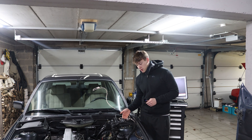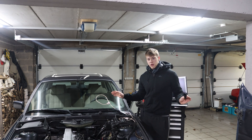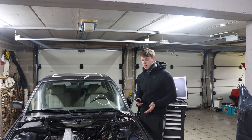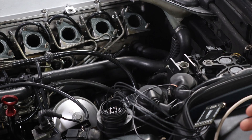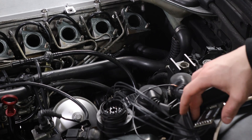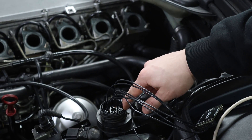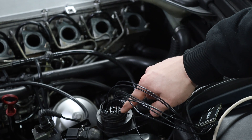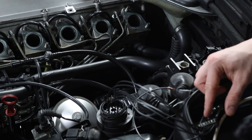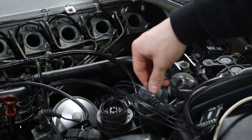Fast forward a week. I've got my tiny ADS interface and just a normal RS232 cable from female to male. Just plug that into the serial port and it instantly fires up — everything works a charm. If you have a car pre-1996, chances are you're definitely going to need the tiny ADS interface because otherwise it just won't communicate with the car. Every car pre-1996 — 1994 and backwards — is full ADS, and that's why you need the tiny ADS interface. You can buy them online, then follow the wiring diagram and get wires into the individual connectors. There are two different possibilities of K-line: one on pin 20 and one on pin 17. Mine has the K-line on pin 20 so I don't need pin 17.